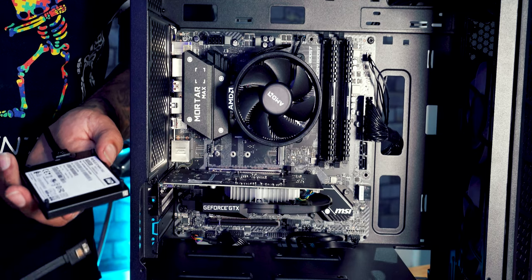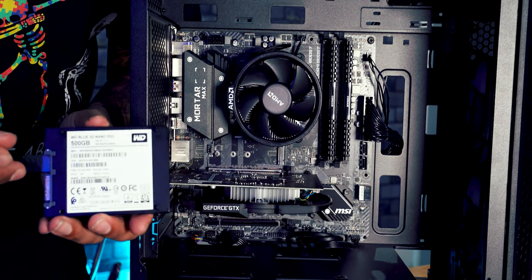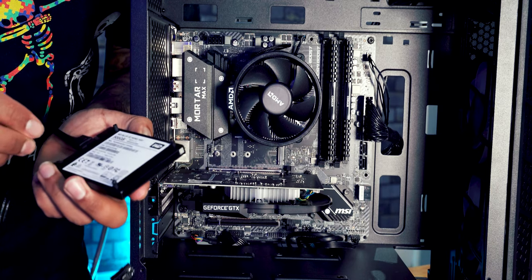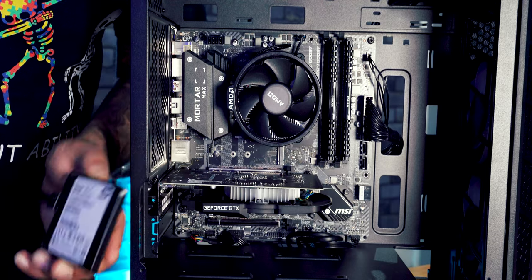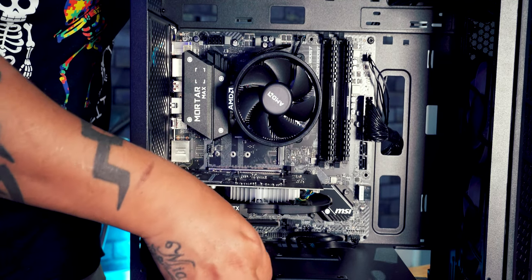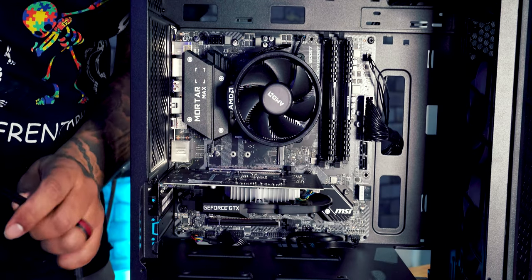So the way you fit hard drives to a case is different from case to case, I find. Like this case is completely different than what I've experienced before. This one has little standoffs. You can see them here, little standoffs that sit up off the hard drive. So you just get them, screw them in, and then you've got some little rubber grommets inside here. So you take these little rubber grommets by the looks of things and you place them in these holes. Then when you've put the little rubber grommets in, these little standoffs will just push straight into the grommets.